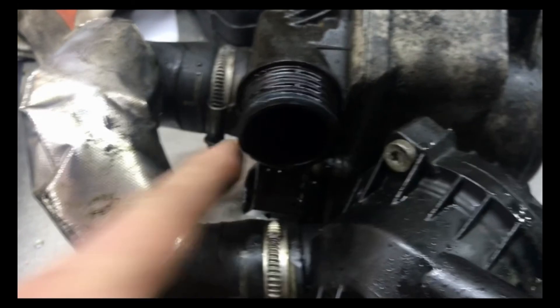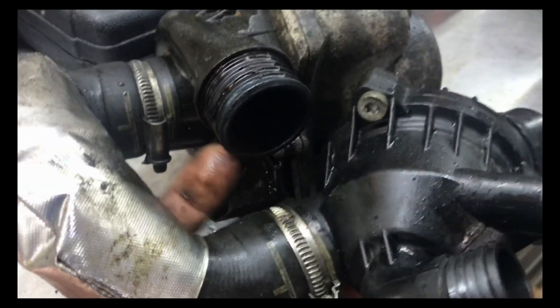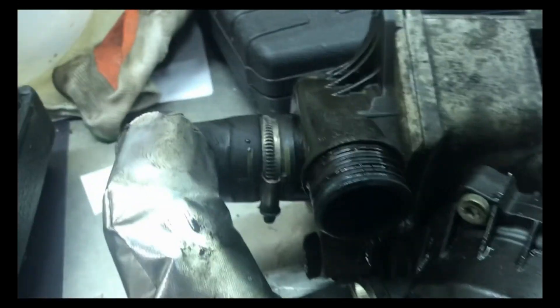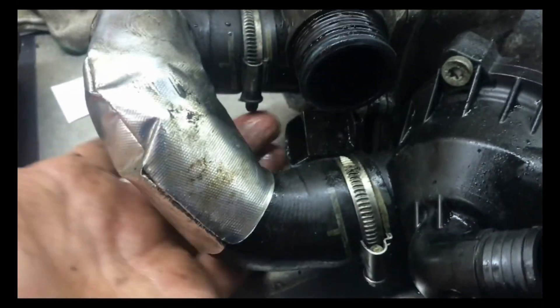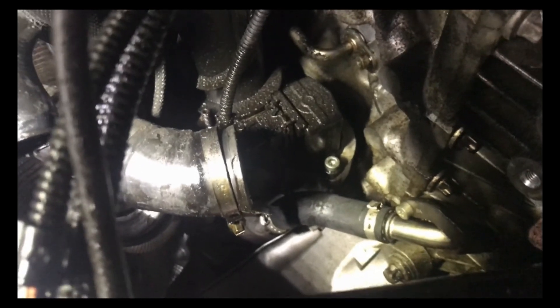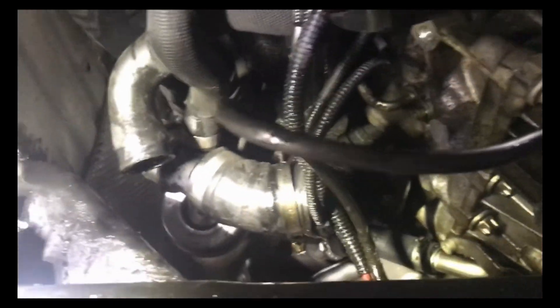What I was able to do is — this hose — you can get to this clamp through here. I was able to get this clamp taken off and pulled, and I was able to finagle the whole thing out. I'm going to try to put it back in the same way. If I can't, I'm going to disconnect this hose clamp, put this unit in first, and then sneak the thermostat in. That's the hose there that goes to the back of the water pump, and here are some of the other hoses and the electrical connector that sits up there too. It barely fits out the hole.